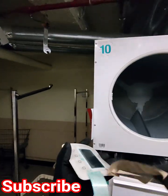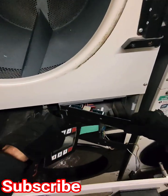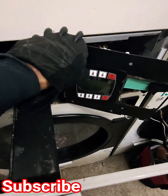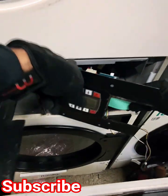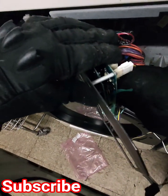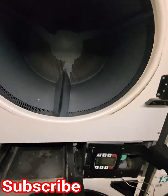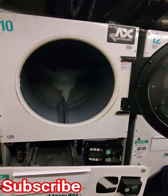And you replace it. You just take off the back, peel off the back, feed it through the hole, line it up. Now you can just line it up back to the spot that it was in before, because you can see like the dirt marks going around. And then you just go back here, fold over the ribbon cable, and put it on, bang. Put it on, close it up, and put it back on. That's it. That's how you change the touchpad on an